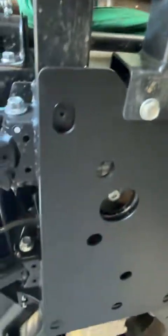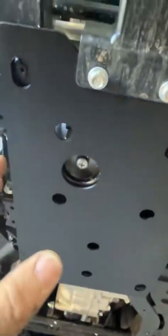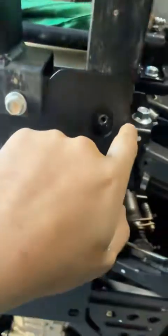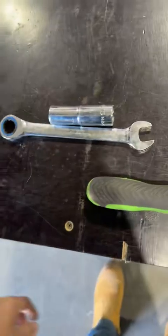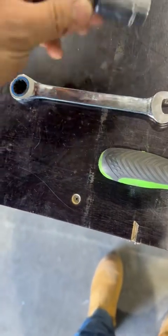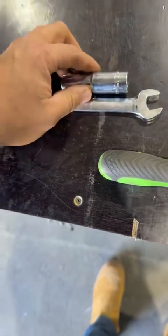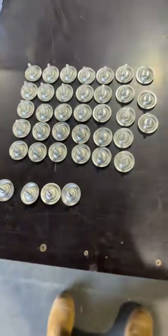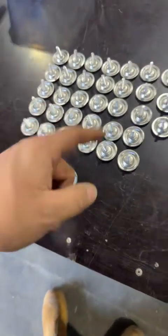Another tip, we want to keep everything really square. So basically just go along the edge. It should fit really nice, the best you can. Make sure your bolts are in the centre there. Your bolt holes are all pretty much central. Yeah, and your diff nut there. Sorry guys, to undo those you'll need a 15mm spanner or socket, and the top ones are 14mm, so take those two out. Alright, back on the kit, we've got our bolts, we've got our little dome heads here.